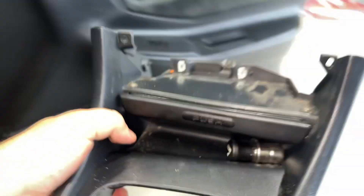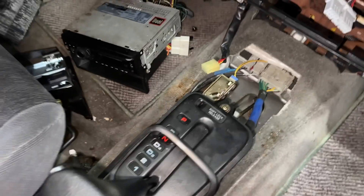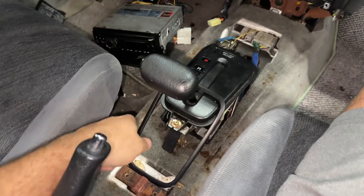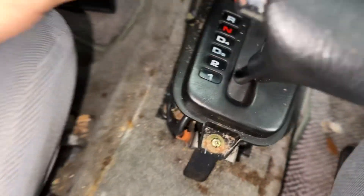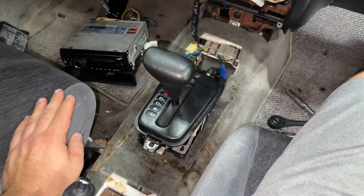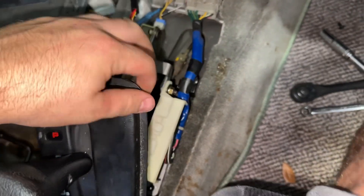All right. It's a big old thing right there. We'll come back to this and we're exposed with all of this. Now, when going from automatic to manual, there are a couple things that you have to do with the wiring harness. You can go ahead and just Google your chassis-specific info for what needs to be done and what needs to be jumped. In this case, we're going to do that off-camera, but we are going to be removing this whole assembly right here. It basically has a couple of mounting nuts right there and then a few more hardware pieces all around this bracket. You want to go ahead and disconnect these wires as well as remove this whole assembly. You can give yourself a little bit more room by removing the Phillips heads that go here and here, allowing this to swivel and accessing the nuts on those studs, and this whole assembly starts to get easier to move around and you can start to wiggle it out.